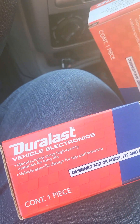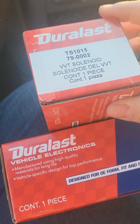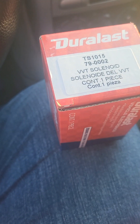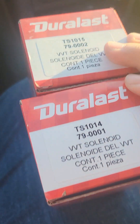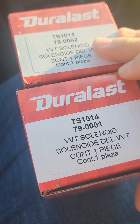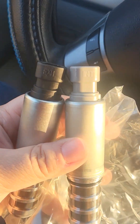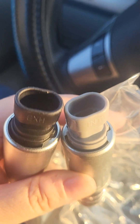What's up guys, it's me again with my 2010 Chevy Cobalt. Today I'm going to be changing the solenoids for the exhaust and intake for that one code. I decided to change both because once you change one, why put one new part and then have an old part? Quick reminder — it says it right there, intake and exhaust, but just remember gray and black. We're going to be using a 10 millimeter socket with an extension, and I'll show you why you need the extension.